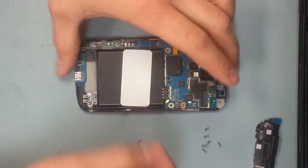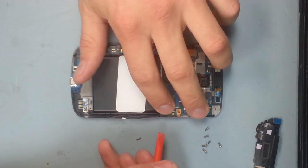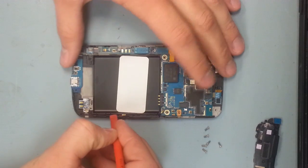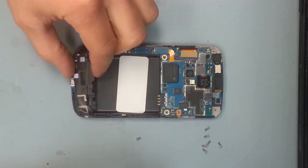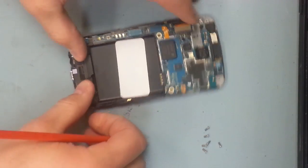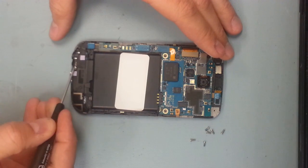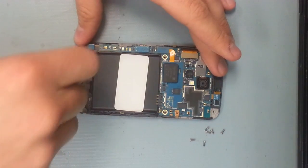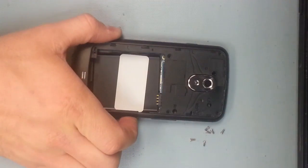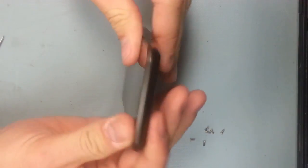I'm going to clip this wire cable back into place. All the ribbon cables and wire cables are kind of like Legos — they only fit in one direction and you just snap them in. This wire cable has guiding brackets along the side that I'm pushing back into place. I'll reattach the bottom plastic piece with the correlating ribbon cable and snap that in, then push the back into place making sure to press all of the little clips which attach the screen to the back housing.